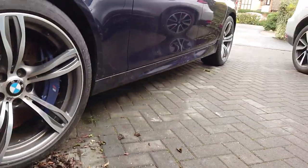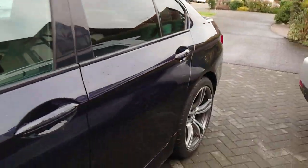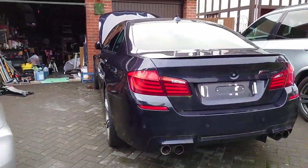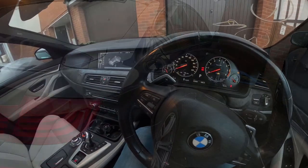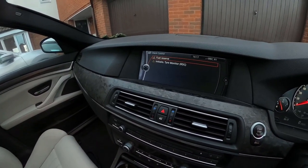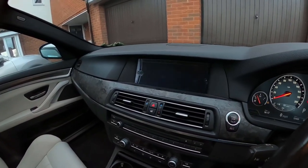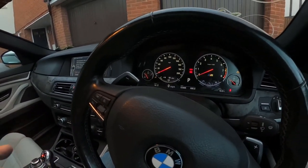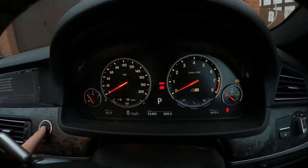She is down on the ground and she is looking good. That'll settle — probably not that corner because it's been loaded, but these will settle. The car is down off its stance and if I look at the check control I've only got the fuel reserve and tyre initialisation warnings. I need to check the oil level, which you need to start the engine for. I've got the exhaust on and the vacuum lines connected — let's press the button and see what happens.